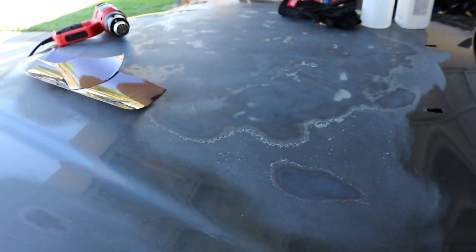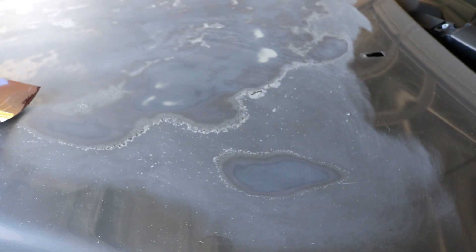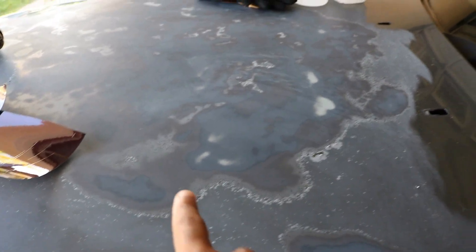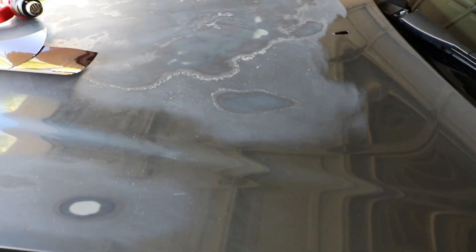As you can see, I haven't done the hood yet. I still need to do the hood and the roof. I tested a piece on the hood to see if the surface issues would show up, and sure enough they do. I thought I might be able to get away with it, but I should have just sanded it down more. I cut a little test piece and stuck it on there, and sure enough if I put the whole wrap on you'll see the outline of the peeling clear coat. So I'm going to have to sand this hood probably completely down.